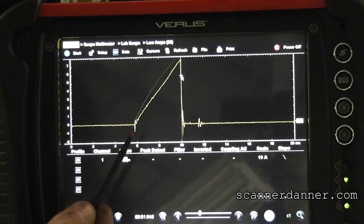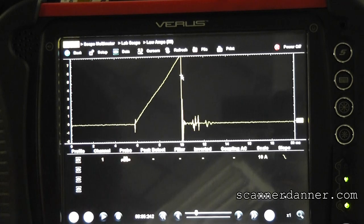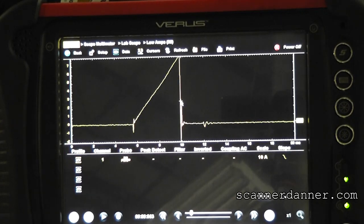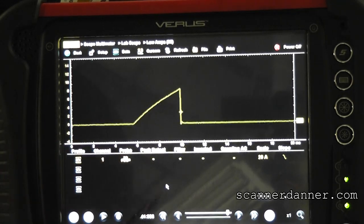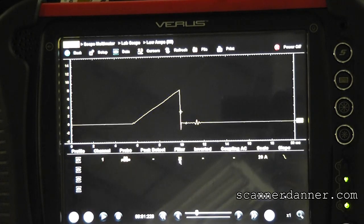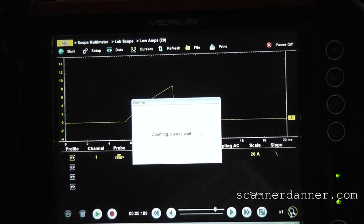Setting a trigger — you can see it here. Even though we have noise, you can see the one coil that has a weird arc and is missing an oscillation right there — that is your shorted coil. All three coils are being drawn on top of each other. Let me try 20 amps and maybe throw a filter in to make this more evident. That's better — see the curve in the one? All three coils drawn over top of each other; freeze that and I'll show you zoomed in.